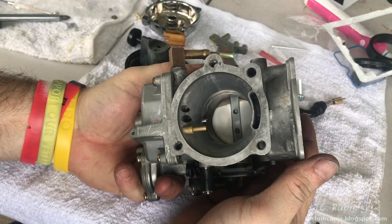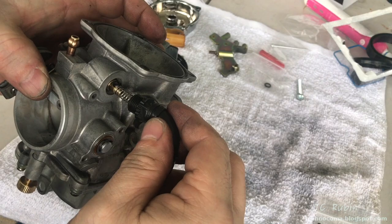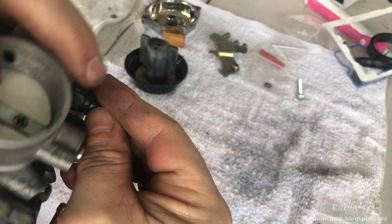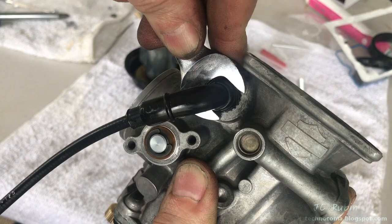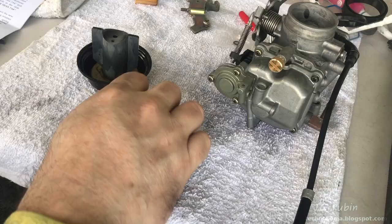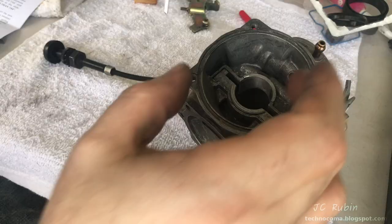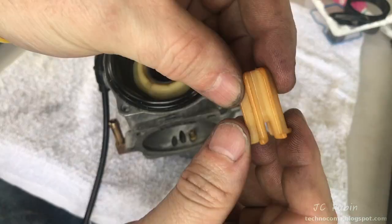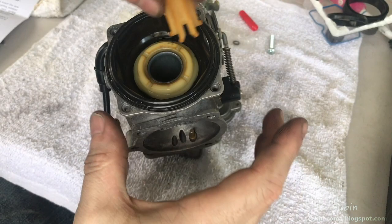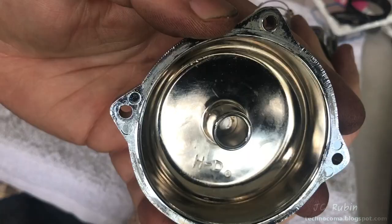The screws are gently torqued down — not too tight as it is aluminum — just gently torqued. There it is: we can see the accelerator pump engage with the throttle. The enrichener is now placed back in, holding the threads and twisting the carb to start it, then ultimately twisting the entire enrichment unit to seat the threads all the way down. It's snugged with the 9/16. Here's the needle that came with the carb, but I'll be using this aftermarket needle from the jetting kit. Dropping the needle into the slide all the way down, then inserting the slide in the correct direction into the carb body. A quick check for binding shows everything is fine — next comes the retainer followed by the spring.